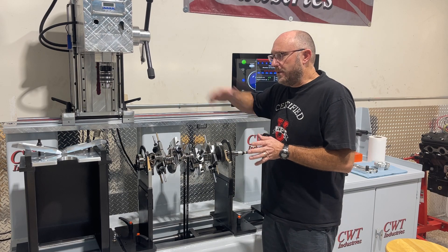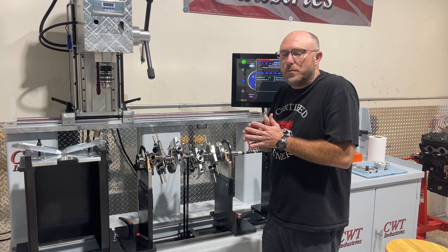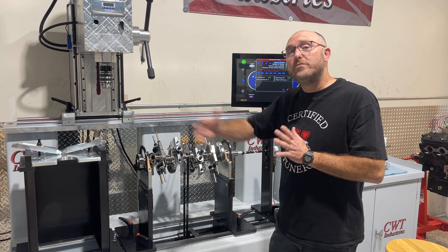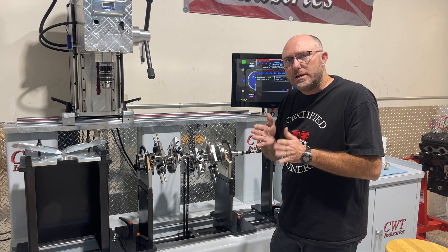If I've got a big long stroke and a big heavy crankshaft, it's naturally going to move around farther when it's out of balance than something with a really small stroke would. So being able to set up a customized ISO standard makes sense — ISO is pretty reliable. Based on the ISO standards, we can put in the weight of our crank and the RPMs we're going to run, and we can have it calculate what our allowable out-of-balance would be. Meaning if it's worse than that, we can do better; if we can get the number smaller than that, there's not really a lot of proven historical value in going further.